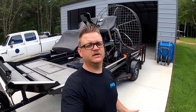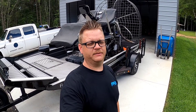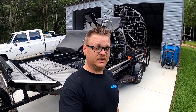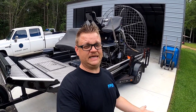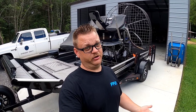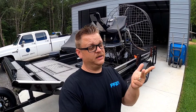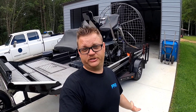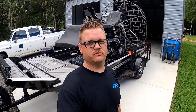Welcome back to another episode of Junk with Junior. We've got an airboat to work on tonight. My buddy Kevin brought it to me — he had some metal work redone on the boat, updating the design a little bit. It ran for a while, now it doesn't. He diagnosed it before bringing it to me: the sight glasses on the carburetors don't show any gas in the bowls, so the fuel pump's not working somehow. Could be a loose ground, no ground, power issue, or a switch — could be a few things after metal work. We're going to get this thing in the shop, get the power probe out, and start diagnosing.